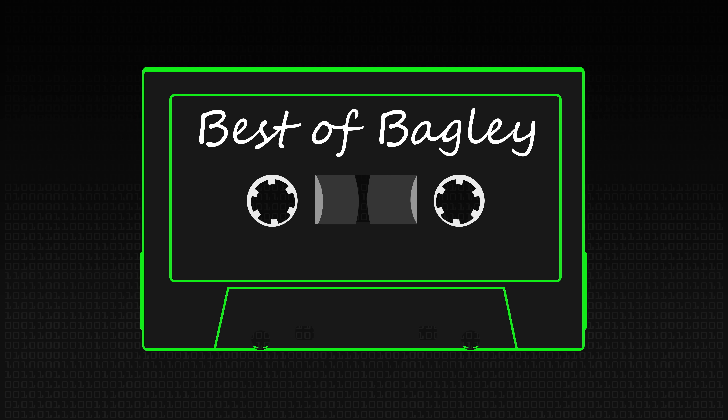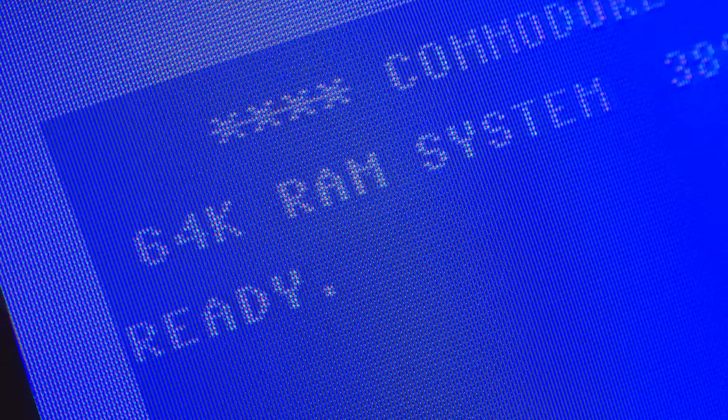When doing this you want to make sure the system is stable, and one of the problems with cassette tape is that it wasn't that stable. If your battery started to lose power, often the pitch of the music you were listening to would drop because it was linked to the power. That's fine for music because the wow and flutter is imperceptible, but for a computer program that's a real problem. What Sinclair did when they designed this is they chose values for how long those pulses were — whether it's a zero or one — such that if there was wow and flutter the computer could still cope. Commodore actually went slightly further: they stored two copies of the program one after the other when they recorded it, using a series of long pulses and short pulses to represent zeros and ones.